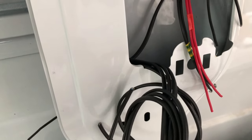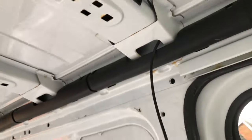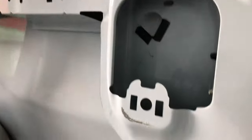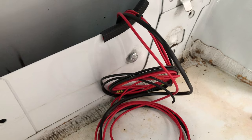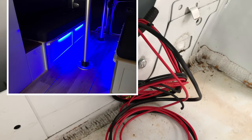So that's for your three lights — you've got one there. Carrying on up, you can see the next set going along. That cable — I've not put it in yet — will be for the switches down here. That's the cable which is going to run over to the switches for your footwell light as well as your bench lights.